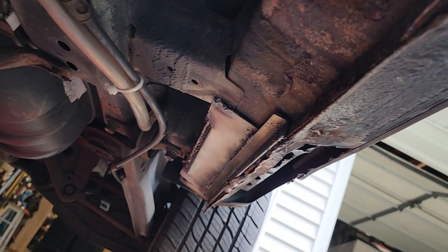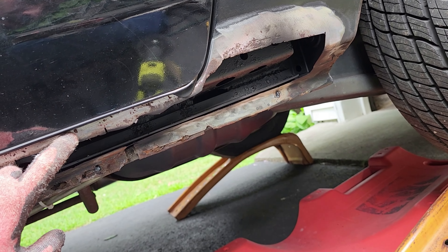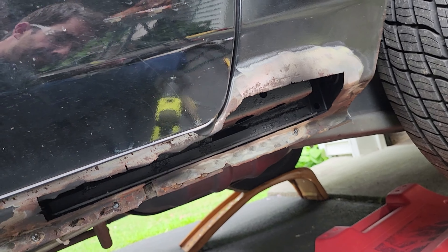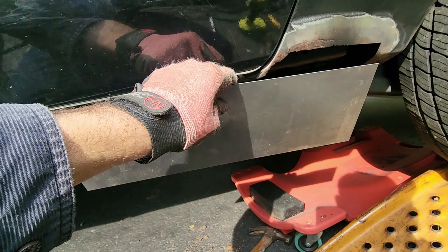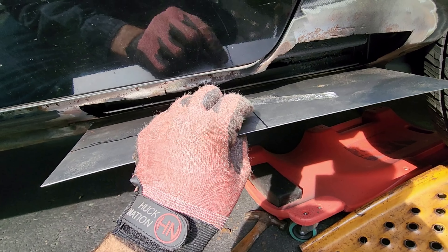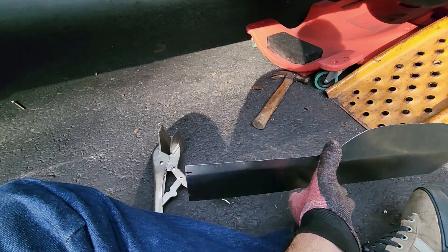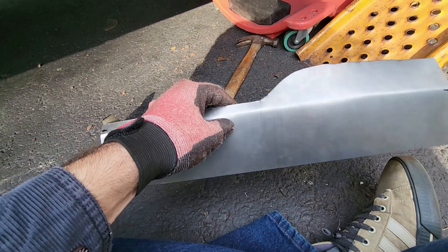I'm going to paint it up, spray it in, make it all black so you don't even notice it. Then come out here and try welding this thin sheet metal to the body. That's going to be a challenge. Here's the metal I'm going to use — it's a 22 gauge sheet metal, which I know is a little bit thin, but that's what I got. I just did an initial tracing of what I need to cut out, so I'm going to cut this little rectangle out first and get a little more detailed with it. First cut and bend — I'm using these vice grips that have a nice flat bill on them so I can bend the metal in a pretty straight line.